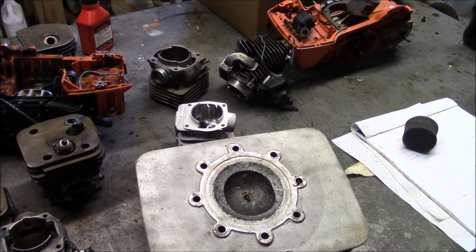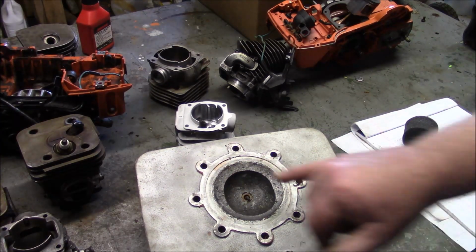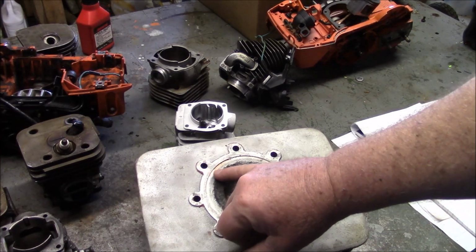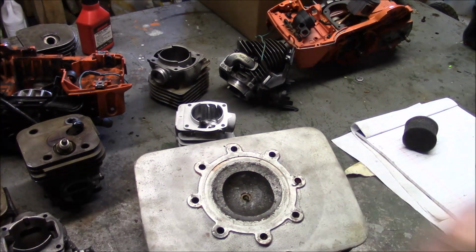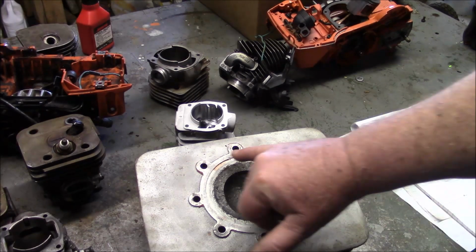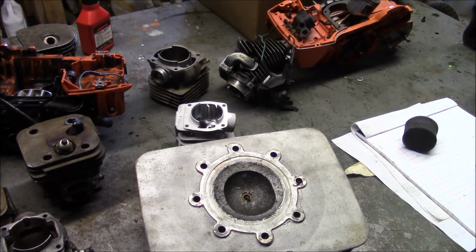But the whole concept with that is if you have too much distance between the piston and the squish band, there's a certain amount of material which won't be burned efficiently. In some cases, there's this nasty distance where it's a little bit too close to actually burn, but then it's not close enough to squeeze that material out. So to get the extra little bit of efficiency or power out of your motor, you take that stuff from in here that would not have been burned because of how tight it was, and actually get it into the combustion chamber for that initial pop, and you get a more efficient motor as a result.